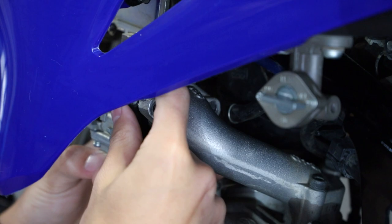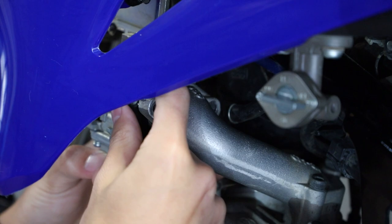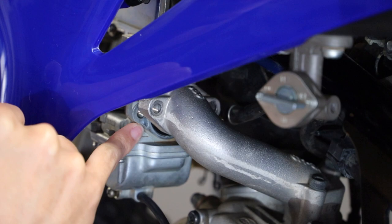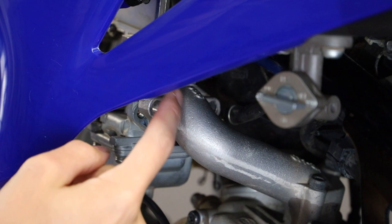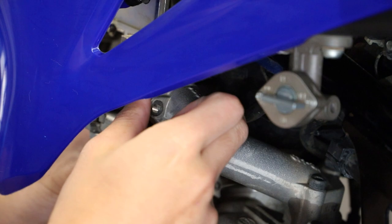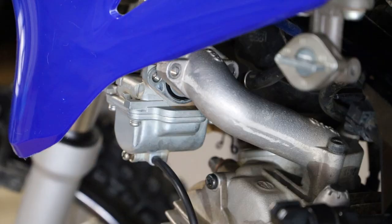I'm going to pull this little plastic plate off because it's going to want to fall — just pull it on out, and this is how it sits in the bike. There are actually two o-rings: one on the intake manifold and one on the carb body itself. Most of the time those will stay in place, but just make sure those don't fall out at any point in the process and that both are there when you go to reassemble. Now that the carburetor is unbolted from the intake manifold we can wiggle it around and get better access to all of our float bowl screws.